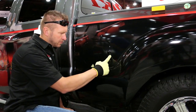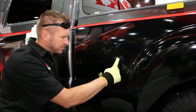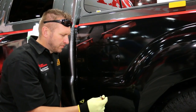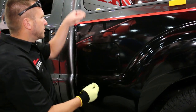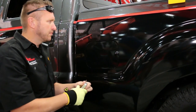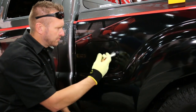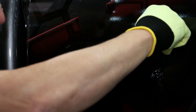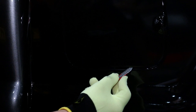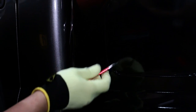It's time to use the knife. We've got Albert Hatfield from 5150 Wraps out of Florida, and he's going to show you the way he cuts. You'll notice he's going to lay the blade off to create a little bit of material to wrap around the actual door. He's bracing his blade against the door as opposed to the body of the truck, keeping more of the material from this cut for the actual body of the bed. The angle of his blade stays the same — always about 45 degrees, laid off in the direction he's going. That's the part that never changes.